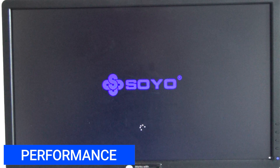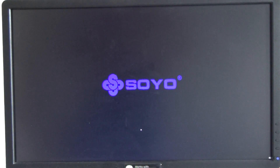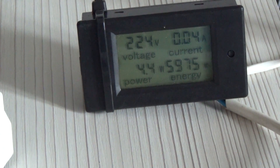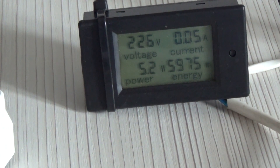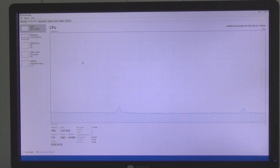Let's run some tests for system performance and stability. Starting with boot speed: 40 seconds from pressing the power button to full boot — not bad for such a portable PC. Maximum power was only 5 to 6 watts, meaning you can generally run this PC from a power bank for a standalone setup. After loading, the average occupied RAM is 2.4GB, with 60–70% free — quite enough for documents, watching video, or browsing the internet. The display is running at 1920×1080.